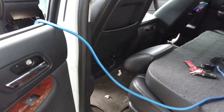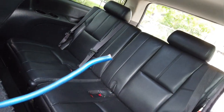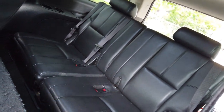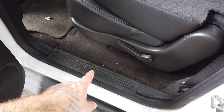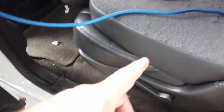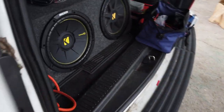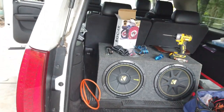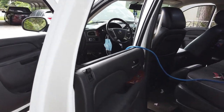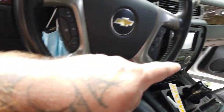This is a big truck and we're running low on power cable — we won't make it all the way to the back. We're going to try mounting the amp right underneath the seat, find a ground somewhere in there, and if we can we're good. We won't need to extend anything. After that we'll start running the RCAs underneath and connecting them to the stereo.